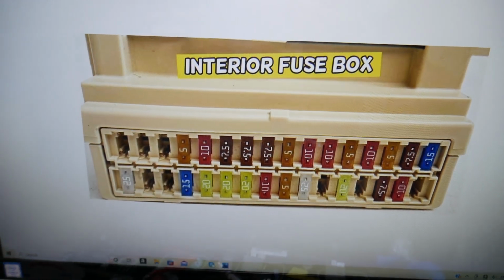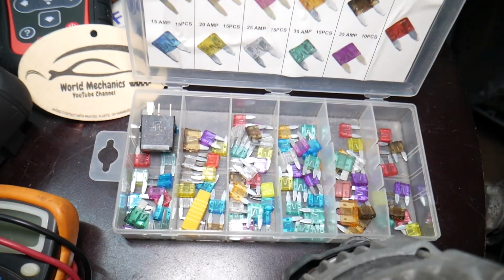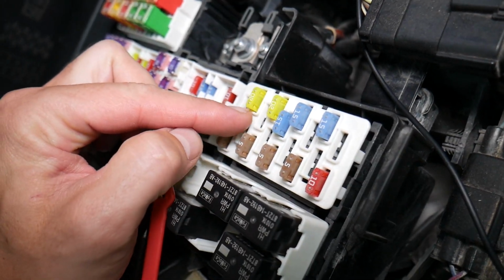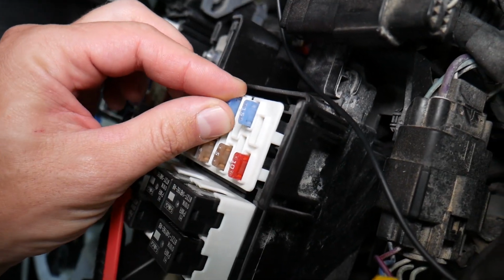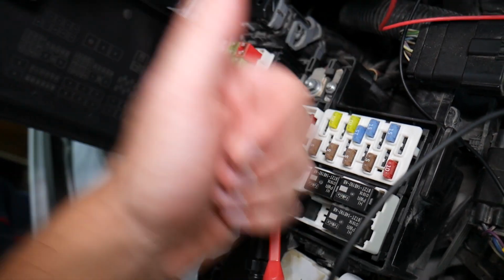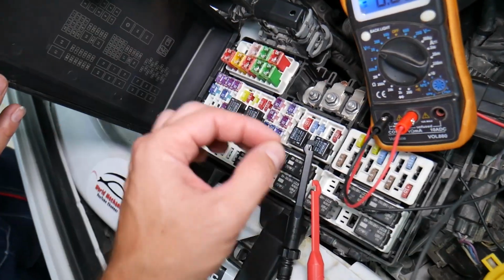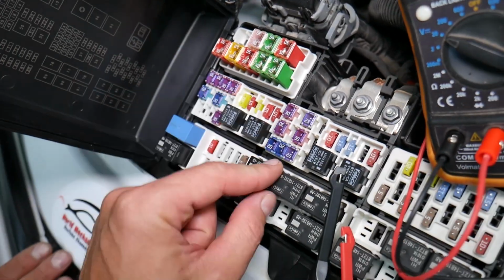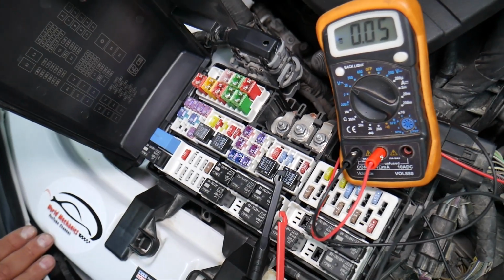Now, before we continue, let's explain quickly why it's always a good idea to test fuses and relays. Super important to test fuses: often you cannot see if they're burnt or good. Sometimes they may seem perfectly fine, you think it's a good fuse, you put it back in and you end up spending money and time on parts and problems that do not exist, when all you had to do was test your fuse, find out it's bad, replace it, fix your problem. So we will have a video on how to test a fuse, different kinds of fuses, and how to test relays. We're going to put the link in the description of the video below specifically to that video.